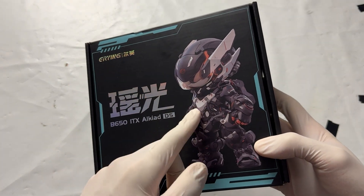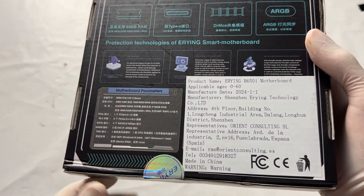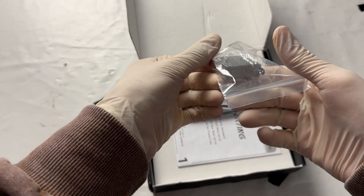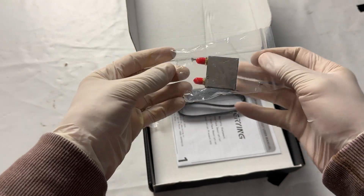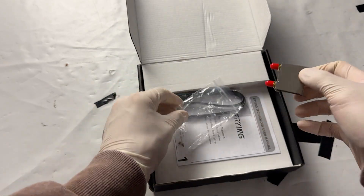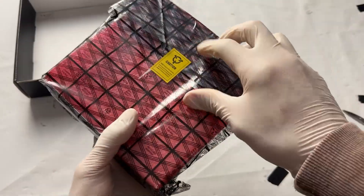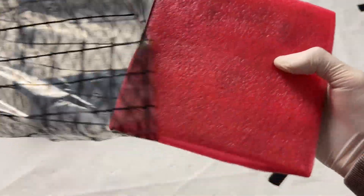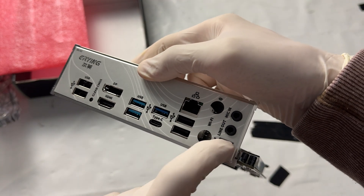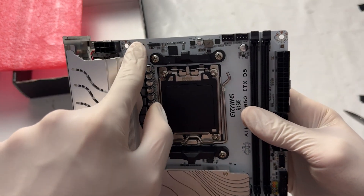Let's start with the unboxing experience. Just like the other one, it's not very satisfying, but the box itself looks really cool. On the inside you get a SATA cable and an extra Wi-Fi adapter, because you can plug in a PC adapter for Wi-Fi and Bluetooth on this mini ITX motherboard. Don't be fooled though — these motherboards do not come out of the box with Bluetooth and Wi-Fi, they're just compatible. What you do get is a very good I/O back panel with a clear CMOS button, which is one of the most important features on a motherboard and they've put it on a $100 board.